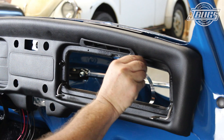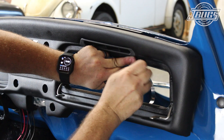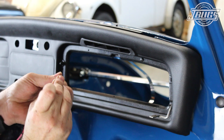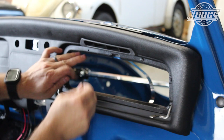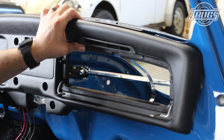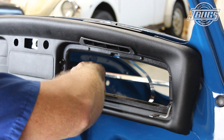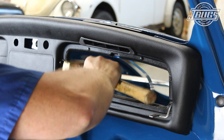There are four small plastic rivets that install at the top and the sides. First, we break off the post, insert the post into the head of the rivet, and then push the rivet into place through the trim ring, the vinyl, and the metal dash. Finally, we push the plastic post into the rivet. Using a small socket as a press and guide and a punch to push the post helps. The larger pins at the bottom are installed in a similar way using a socket to press the rivet down, but then there's no room for a punch, so we pull the socket out and use a brass hammer to tap the post in since our rubber mallet has grown legs.